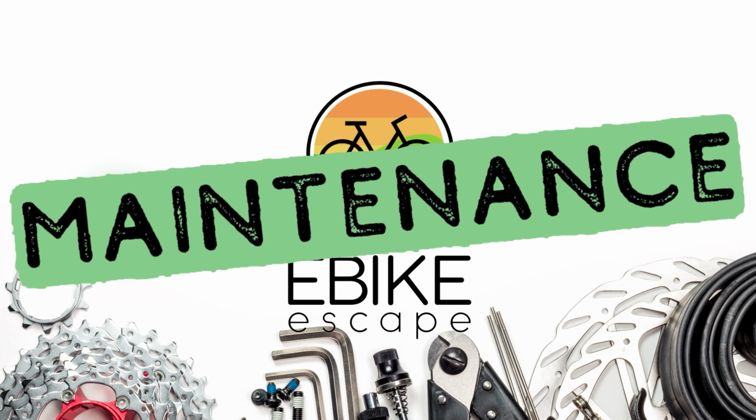And then probably the biggest one that I see is this little piece right here. We got one over here to show you what it looks like off the bike. But this piece here could have gotten bent at some point, and even the slightest little bit on that piece will cause the shifting to be thrown by enough to where you're going to notice it. It's going to probably make some grinding or some clicking noises when going through the range. So those are some common things that I see on these to kind of check for.